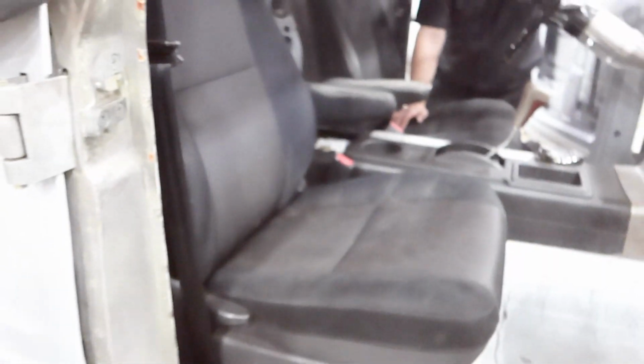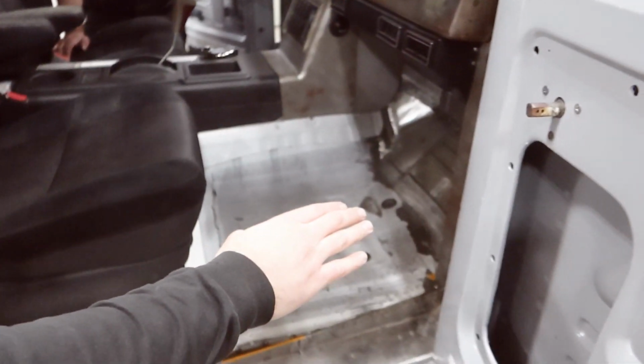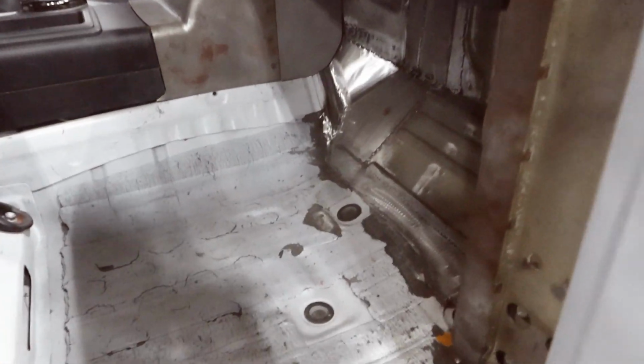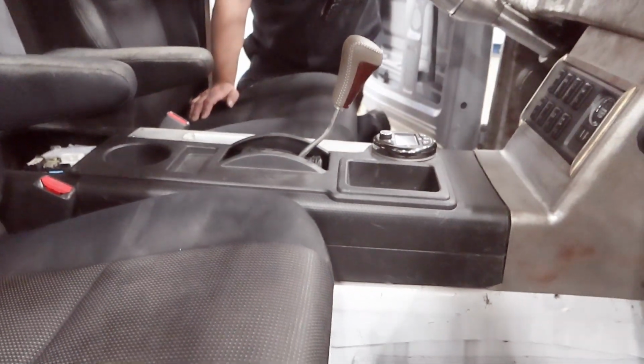And what are these out of? Are these the Lexus seats? Those are late model FJ Cruiser seats. So a cool thing we found out along the way, this has the full Lexus floor pan welded in, which integrates it to the chassis. But Toyota being handy, this is the same floor pan section as an FJ. So late model FJ Cruiser seats bolted right in.